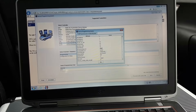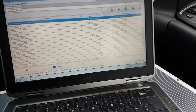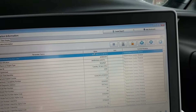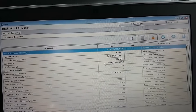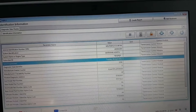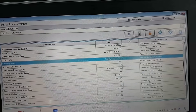Let me think about how to approach this. I'll just quickly run a GDS2 diagnostic under ECU information to confirm - the date programmed is Tuesday 24th April 2012. This is the original module software, so the software versions etc. haven't been updated since then. It's possible the car has never been reprogrammed. Whether there's a software update available, I'm not 100% sure - only online would tell me.